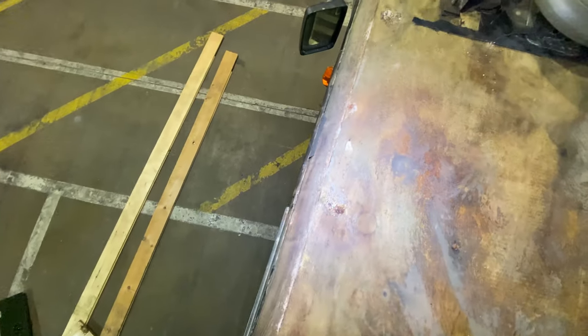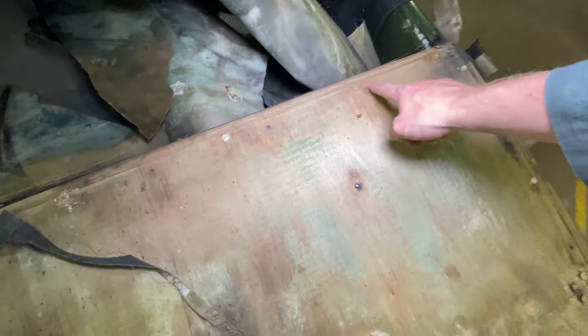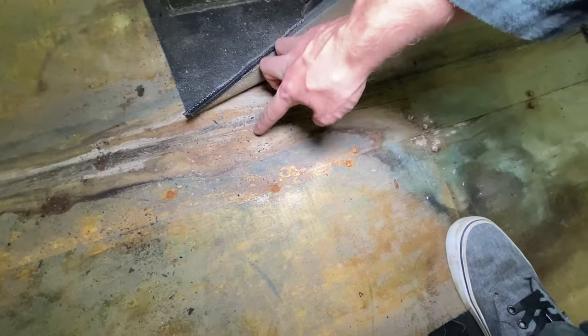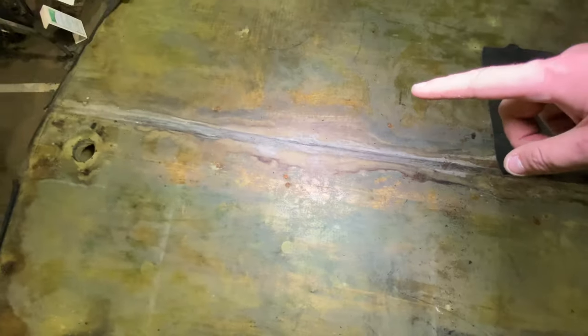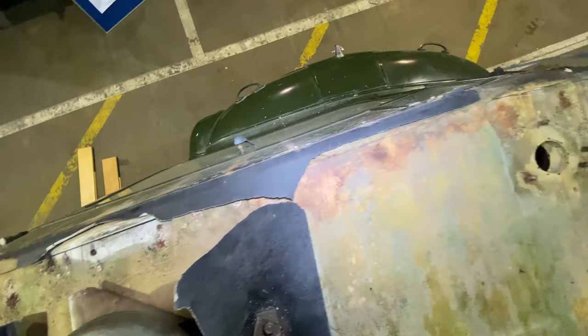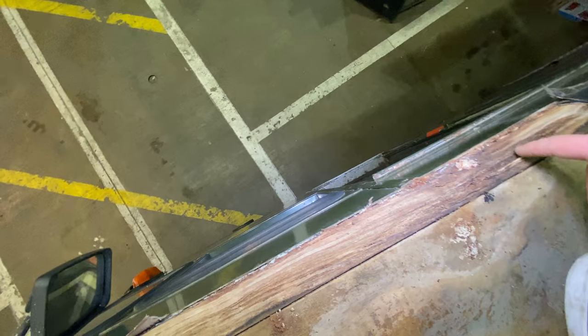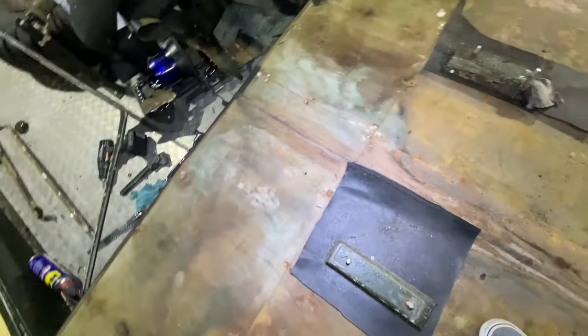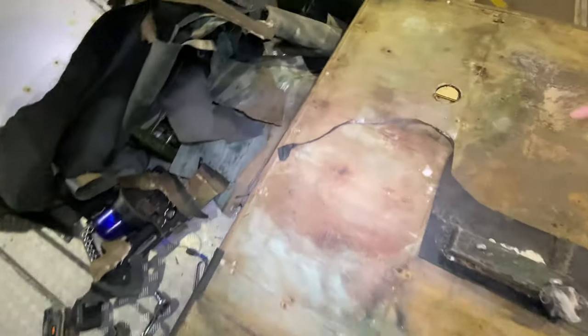Overall, looking at the wood, the majority of it is not that bad. There's quite a bit on this back panel here - you can see where it's split and there's a bit of leakage there. In this centre bit, all the way along where the seam was, you can see this dark area where it's basically leaked in. Coming around to the front, you've got a few small patches but in general it's actually not that bad. The only massive bit that is damaged is this bit here, which is completely rotted away - this side piece. But I think aside from this piece here, you could probably just put the roof over it and maybe replace this back panel.